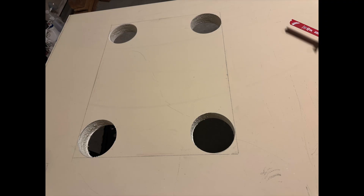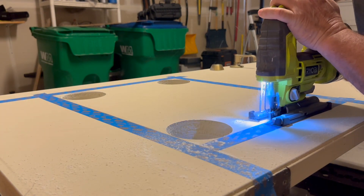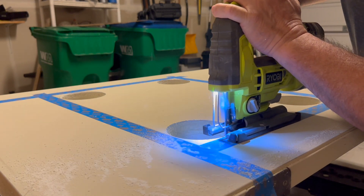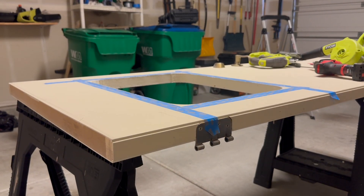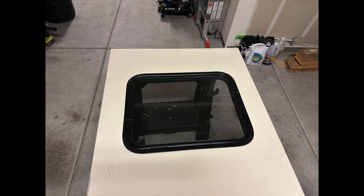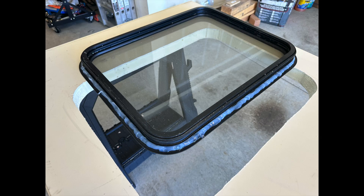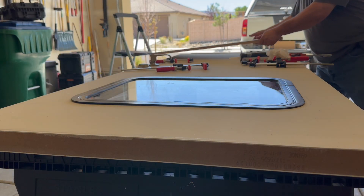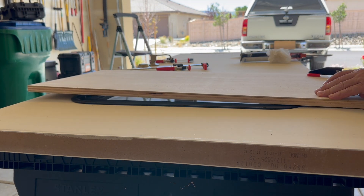To my surprise those doors are made of fiberglass — I assumed they were thin metal but they were fiberglass. I put some tape down and then use my least favorite tool, the jigsaw, and cut the rest of it out. Then I check the fit of the window. I'm making up some shims because like I said that window is too thick. I put some silicone on it and put it in place, and I flip it over using a piece of plywood and some clamps to hold it in place.